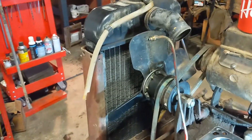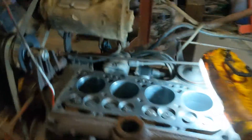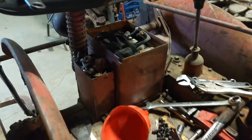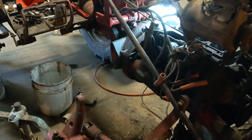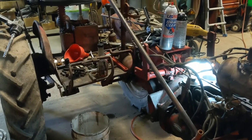What else did I do? I put a new radiator in a couple years ago. Belts. I've messed with the carb a bunch of times. Gotta do a hydraulic pump. I've probably put points and condenser on it about a thousand times. Plugs. I don't know if I've ever done wires — probably not. There's all the parts — look at all that stuff. Still a six-volt system, which is hooked up because, you know, it's not done right if you unhook the battery. You gotta stay awake — keep the battery hooked up; it lets you know you're still alive if you touch something you ain't supposed to.